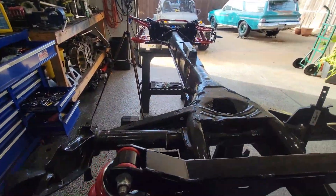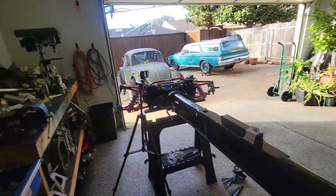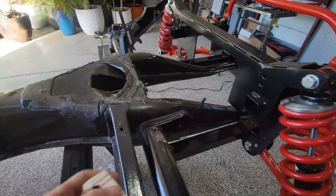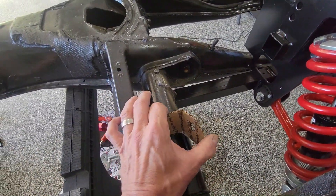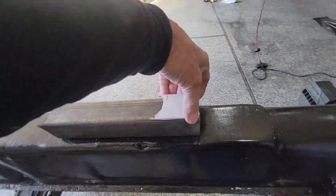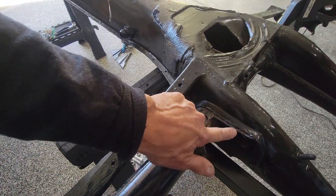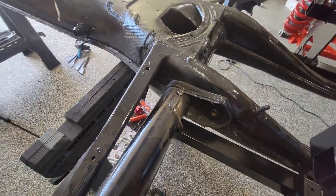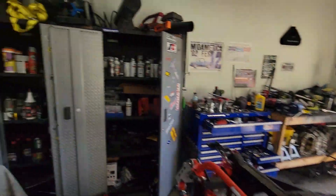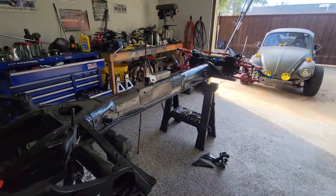Like I showed y'all, I had to cut off these independent rear suspension brackets, and I'm going to have to make a bracket. I found some box tubing I had and made a template — real simple, it goes underneath and mounts just like that on the underside to hold it. I'm going to cut it out of this box tubing. Then I'm going to grind off all this excess junk here — make it clean, because it probably adds a little bit of reinforcement. That Evolution saw is the best saw I ever bought in my life for cutting metal — it cuts like butter.